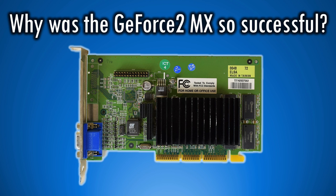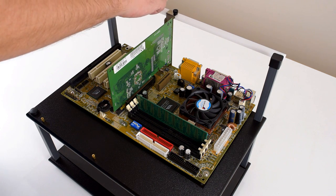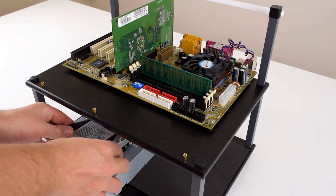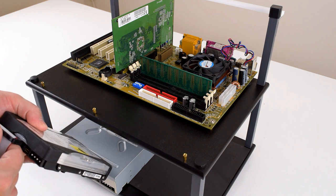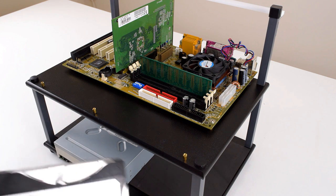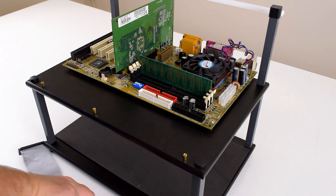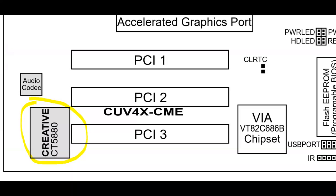Check out the links in the description if you want to watch that. The card is compatible with AGP 4X, however in my case the Nvidia driver forces AGP to 2X when it sees the Apollo Pro chipset, because the chipset can be unstable when using AGP 4X. I've experienced this with an ATI Radeon card which enables AGP 4X mode but then locks up the machine on a pretty regular basis. It's not a big loss though — there's almost no performance difference between AGP 2X and 4X with this graphics card.